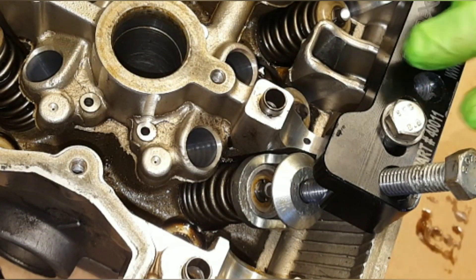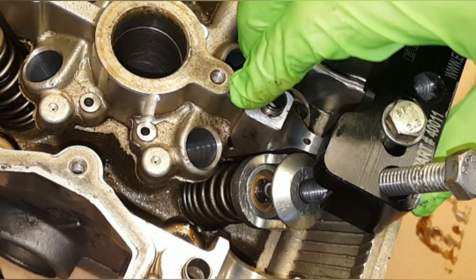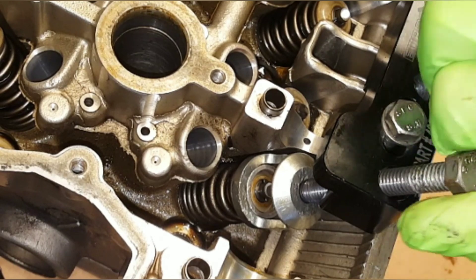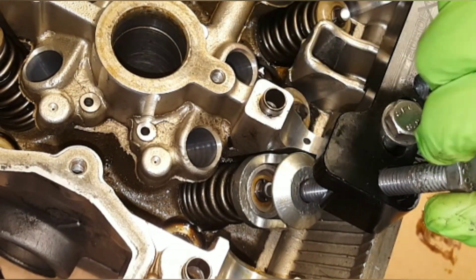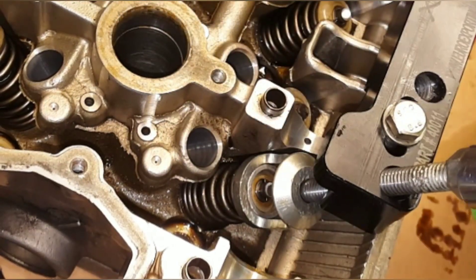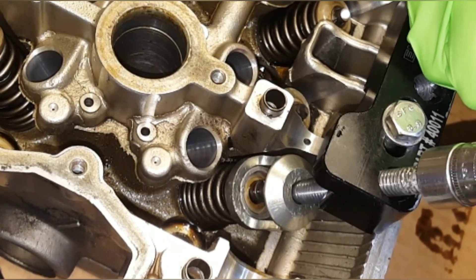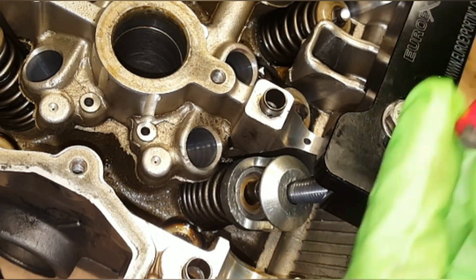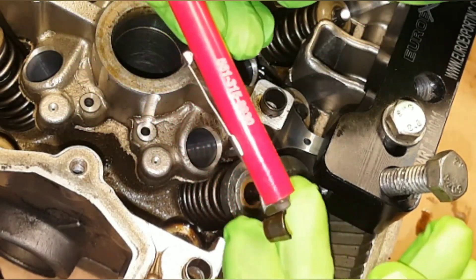So we have it all bolted down. The bolts that secure the block are 13 millimeters, and they bolt into the cam cap threaded sections. This central bolt is a 14mm and threads down into the block that is part of the kit. It's important to run this down by hand until you stop up against the little cup, and then bump it a couple of times with an impact driver. You'll see the spring and retainer come down and the keepers are freed up. I have the little magnetic tool that comes with the kit — just go in like that, and it's out.